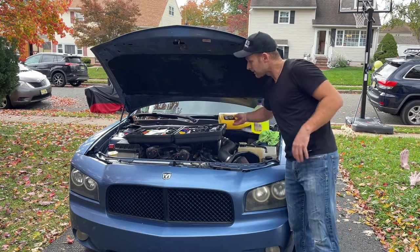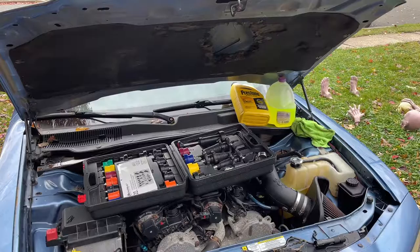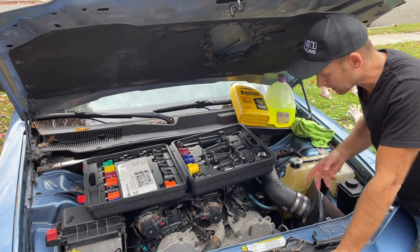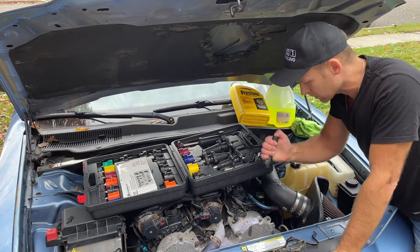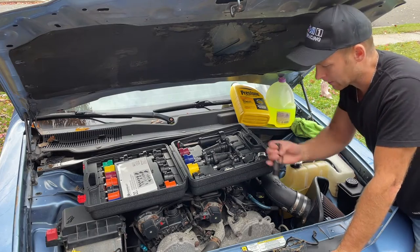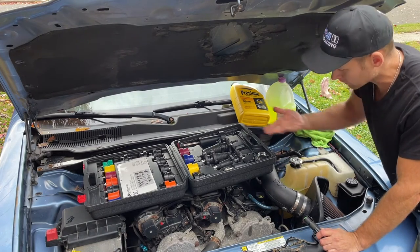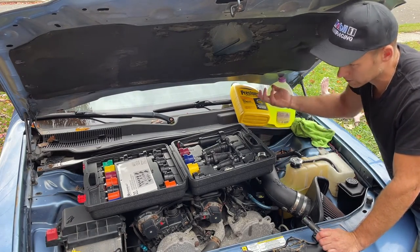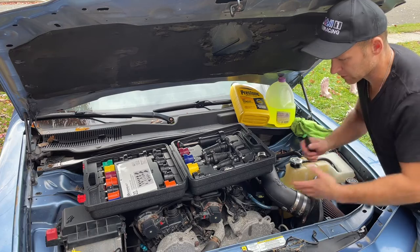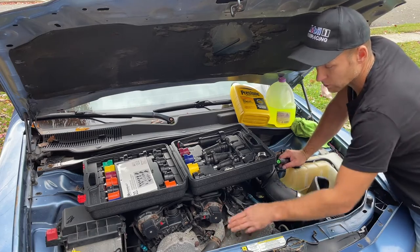I'm going to show you guys how I use this kit to test if there's any leaks before we start assuming other issues. Before you even start doing all this testing, the first thing you do is grab a flashlight and check everywhere to see if you already see any leaks. Obviously at the moment this happened I could see a leak, but I didn't know where it was coming from. So when you refill your reservoir, see if anything's leaking already. If not, you do the pressure test. If you don't have this kit, another way is to start your car up — when the car heats up and the thermostat opens, that's when all the fluids will start flowing through and you'll see where the water is coming from. Check your hoses and the clamps on the hoses — that's number one.